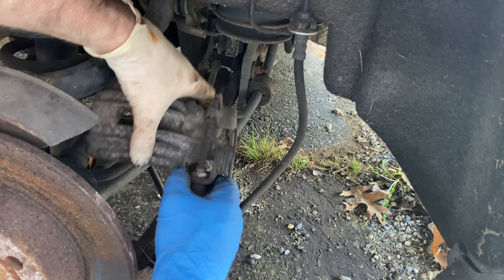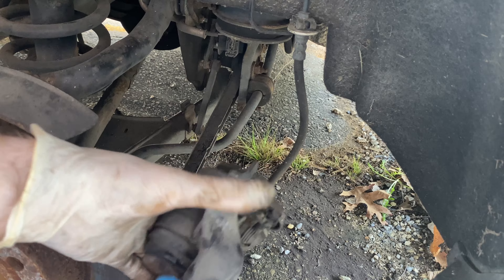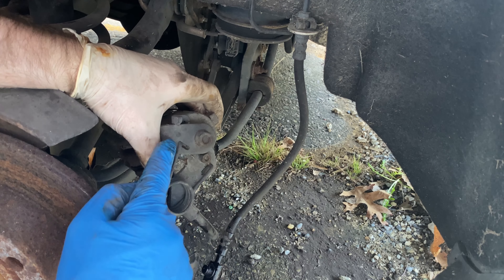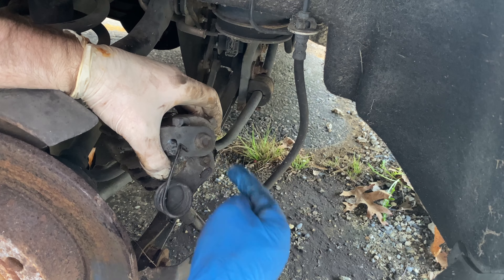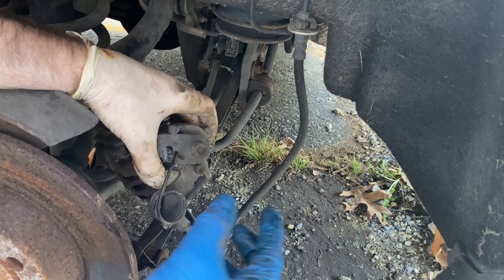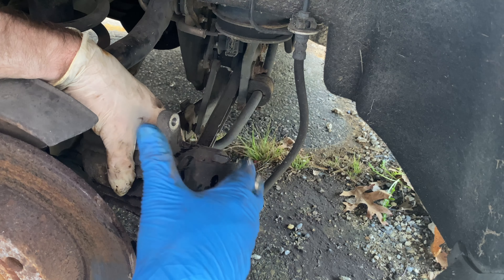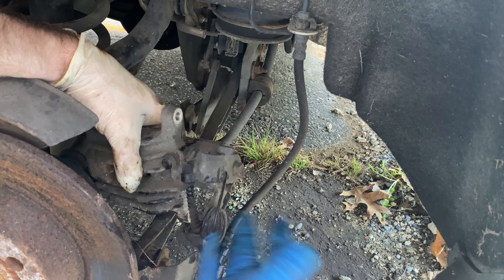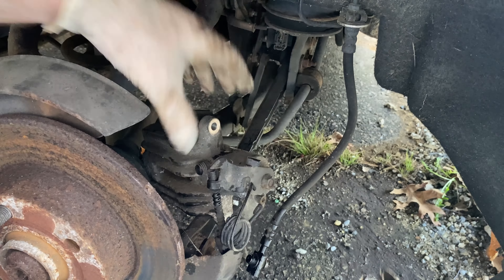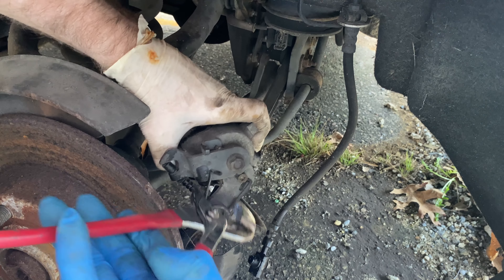The last piece is the emergency brake cable. I like to get a pair of grips and grab the spring. This section only goes one way, but this part goes around and connects right here. Once you pinch it, you can pull the back section up and it'll come out — just be very careful it doesn't come off and smack your fingers. Once you do that, the cable will move easier and then the caliper is free. I'll get my channel locks and position them about halfway on the spring.